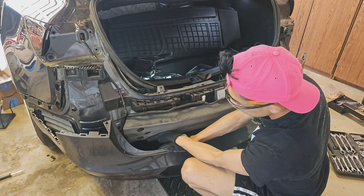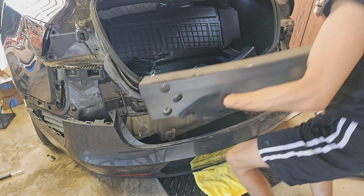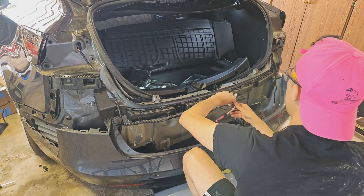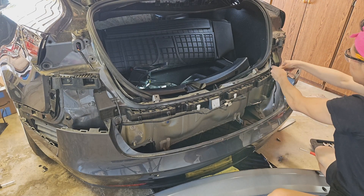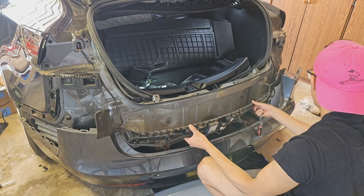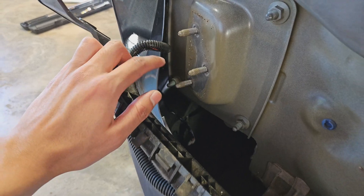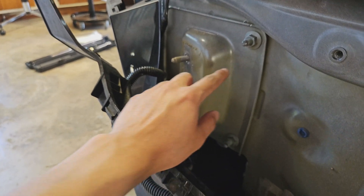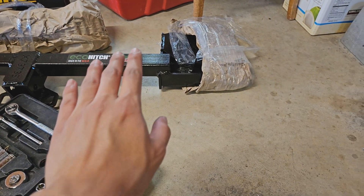Once you have all the bolts removed holding the crash bar to the subframe, just take the crash bar off. If you don't have the bumper in the way, simply pull it off. The next thing to remove is this black bar at the top — there are five bolts holding it in, and at the very top on each side there's a clip. It's super easy to get off. Then you can either unplug the sensors or just leave it hanging. Crash bar is off. This is lowered into place so we can remove these bolts. This side has two coming out of it; this side has three. Next, remove this bolt, this bolt, and that bolt — that's going to get rid of this piece of metal right here. We don't need this anymore because the kit is going to be replacing this metal, and the crash bar just goes on top of it.